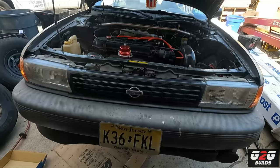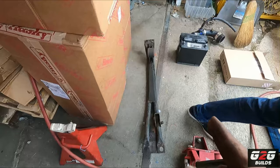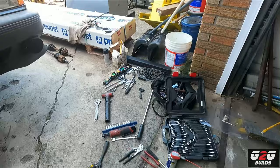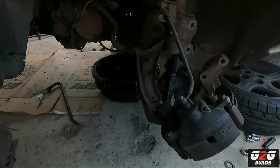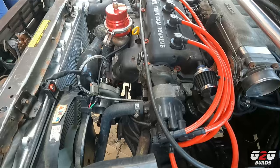I got the car on jack stands, I finally got my crossmember out. I also have the poly mounts I installed a while back - they're very dirty. The axles are out, I already drained the gear oil - you can see the tray right there. Now I'm getting ready to drop the transmission, so I'm gonna put you on time lapse.